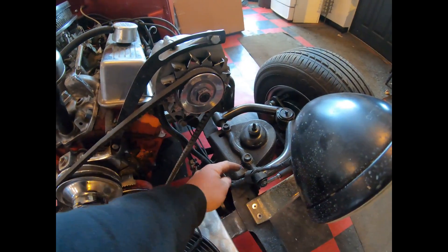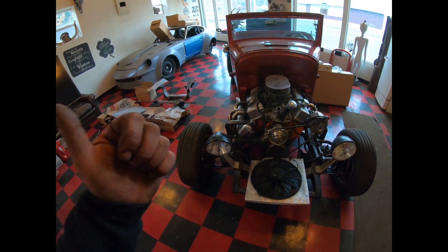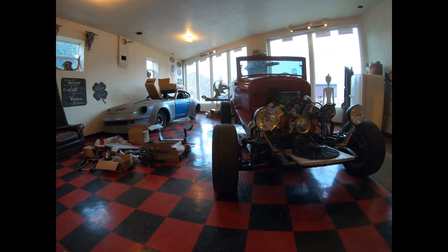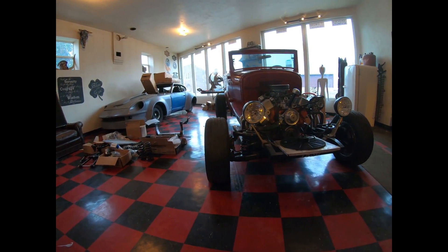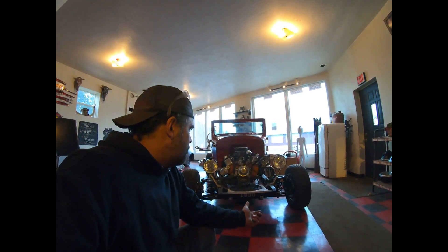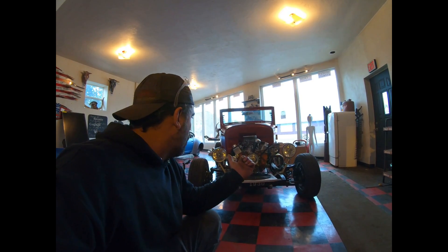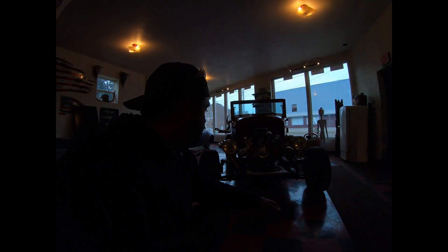The upper control arms are maxed all the way out on both sides on this reference car - ironically the total opposite of the car in the shop. The tire is leaning in severely and the adjustment is already maxed out on the top hat. So basically this one's installed wrong too. I think I can probably get away with cutting the top hats off, relocating them - going out in this case and back. I'll have to figure out the story on that one.